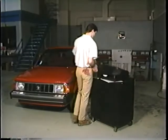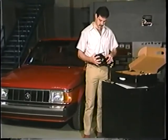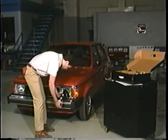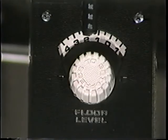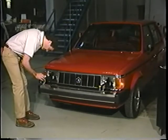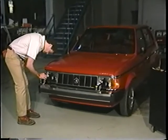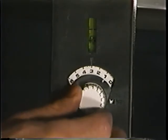There will probably be times when you'll want to check a customer's headlamps to see if they need alignment. This is a good service to offer free of charge and can lead to increased aiming business. To check the aim, attach the aimers to the headlamps just as though you were performing the aiming operation. Remember to check the floor slope dial to see that it is at the correct setting. Check the horizontal aim by turning the horizontal dial until the split image is in alignment — if the horizontal dial reads more than a value of two, the headlamps need aiming. Check the vertical aim by turning the vertical dial until the level vial is centered — if the vertical dial reads more than a value of two, the headlamps should be re-aimed.